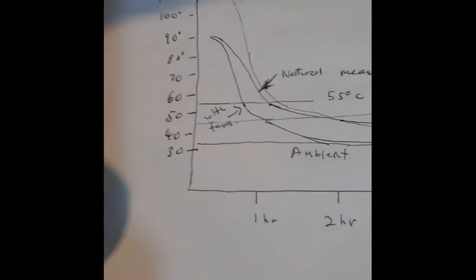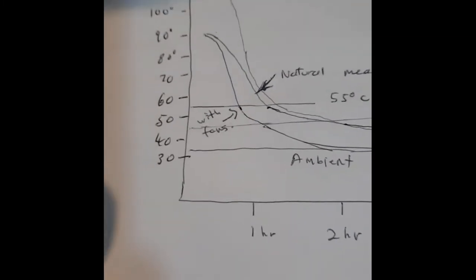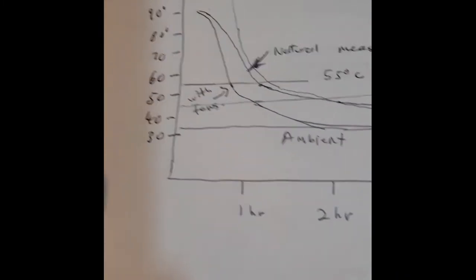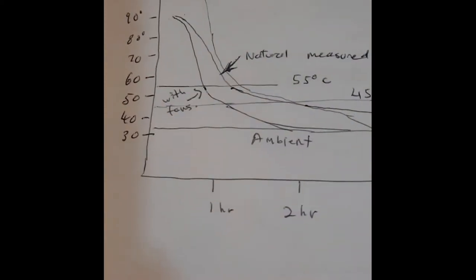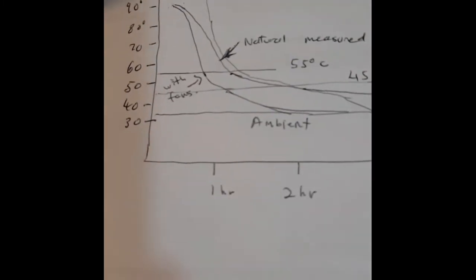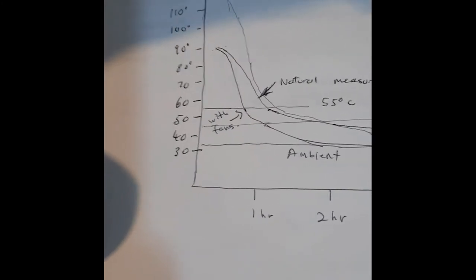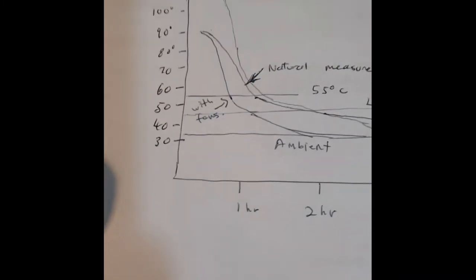I think that's okay. That's a good temperature which will not damage the electrical wires and components, and won't damage the spark plug cables either. So I will not go higher than 58 Celsius. I will experiment with this temperature and find a happy medium. The target is maybe just 1 hour or a little over 1 hour. Since I've done the deflector for the air on the exhaust side, I will test it again and see. I've set the temperature to 53, and let's see how long it takes to shut off the fans.